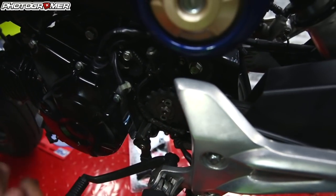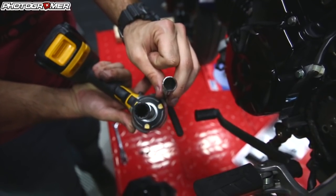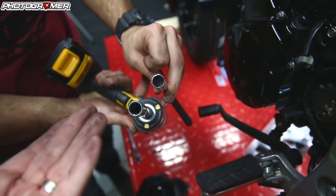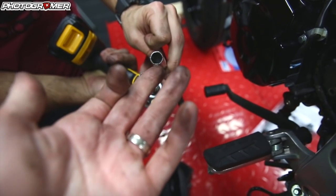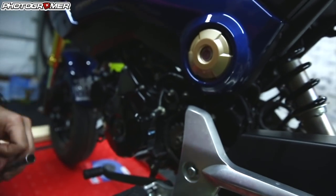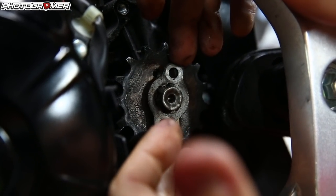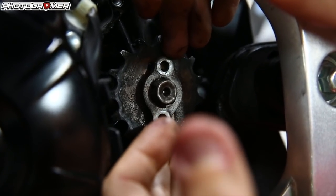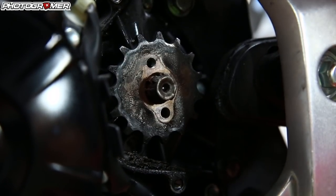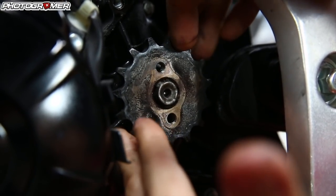There's a little slot machined on the shaft for a tab — you just slide and twist the lock ring until it lines up. That's basically the locking mechanism. There's a groove where it sits and spins free. You pull it out, spin it until you get to the threaded part, then the sprocket slides right off. Now let's put the new one on.